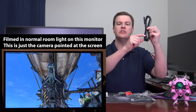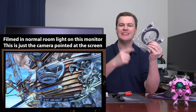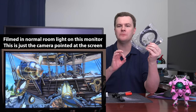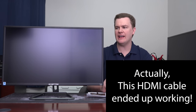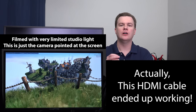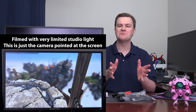A standard power cable is included with a two-prong connection and two-pin connector for the back of the monitor. The only video cable included is an HDMI, and looking at the documentation, it is an HDMI 1.4 cable — not meant to drive 4K at 60Hz. That's a swing and a miss. Why would you sell a 4K monitor and not include a 4K cable? If you want to run over HDMI, you probably need to buy another cable, or use DisplayPort.